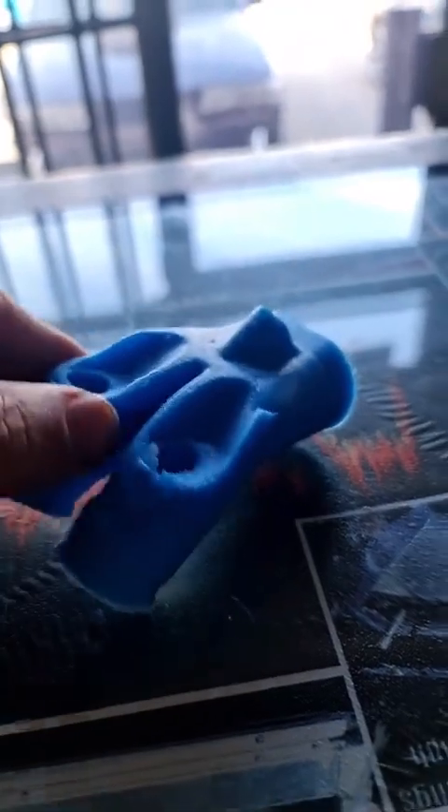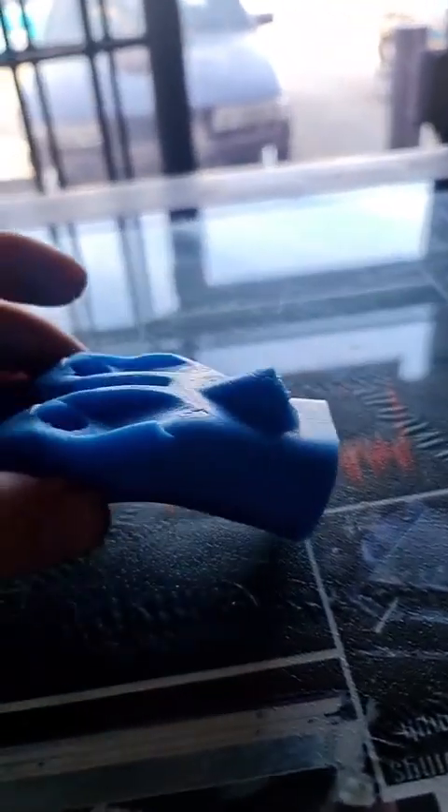I've been doing it that long - I can look at a port now, and most guys that have been in the industry long enough and ported enough heads will be able to tell you by the size of the port where it's going to be within a few percent. This is why I also like port moulding - I get a few people saying, 'Jake, why are you still moulding, why don't you digitise this?' Because seeing is believing, and anytime I can pull moulds out of the toolbox rather than having it on file - being dyslexic, you'll put a number back the front and you'll be scratching your head trying to think what you've done wrong.